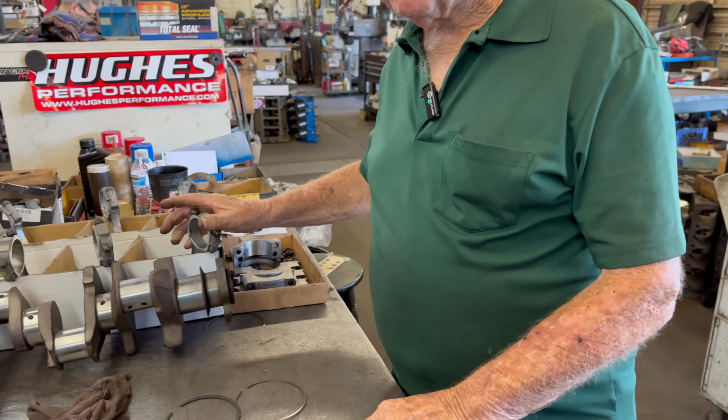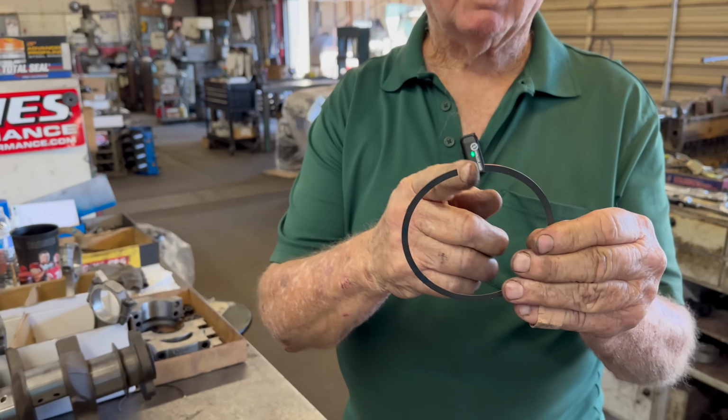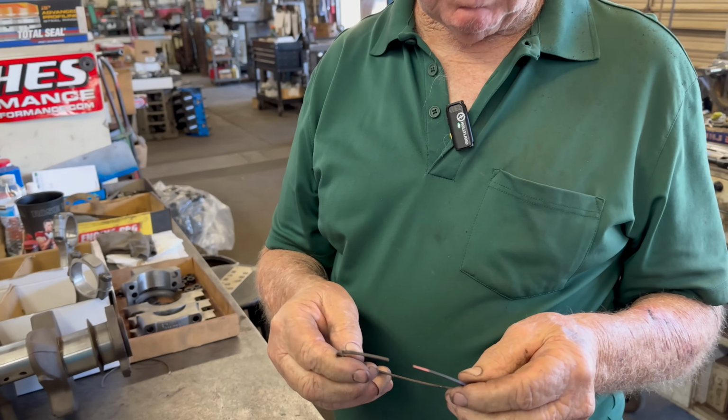And piston top, ring lands, I'm going to get ready to grind the rings. Okay. Gap the rings, we always have to. And on this particular time, we'll run probably 30 thousandths top ring, and 25 the second ring, end gap.